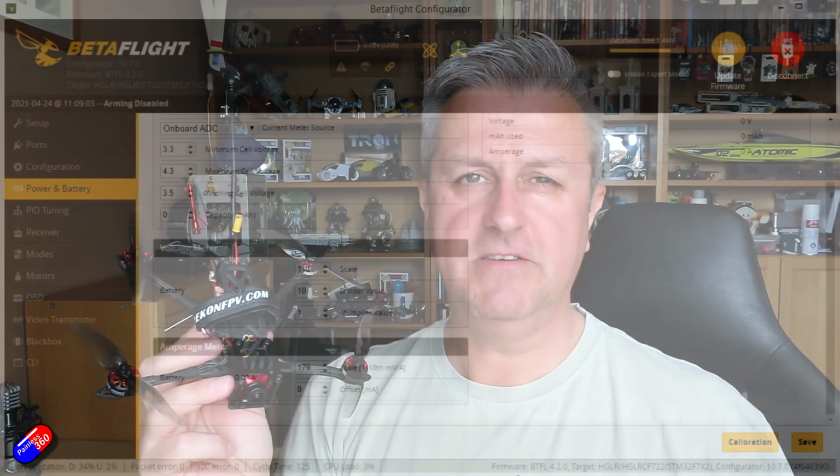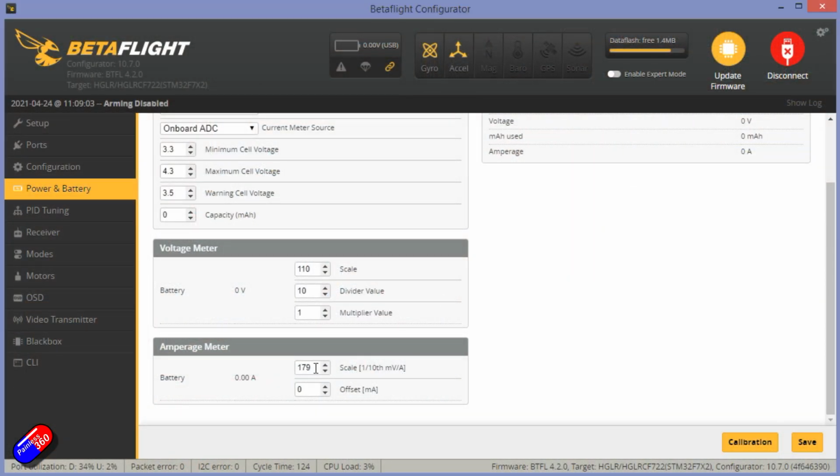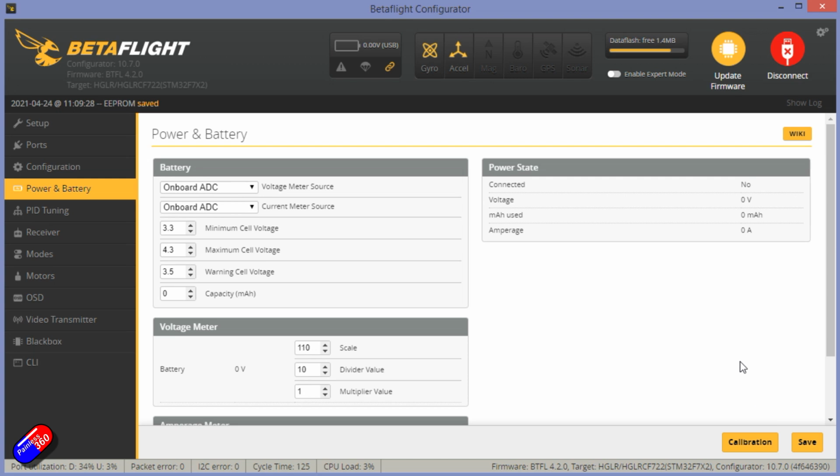As I said, the current, you probably saw in the videos, is reading way too high. You need to change it from 179 to 279 as I show here. That seems to work an awful lot better. Again, if there are any other little tweaks or things I find as I continue to fly this, I'll put them in the description down below.